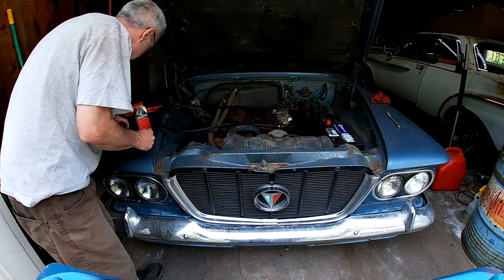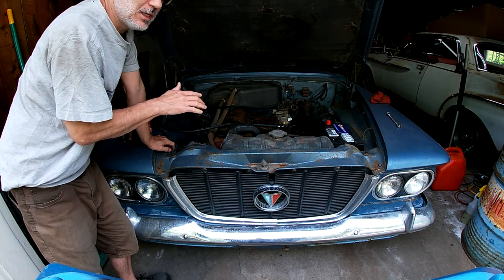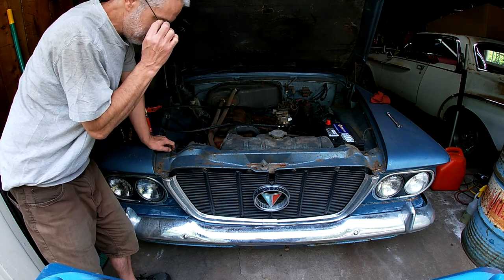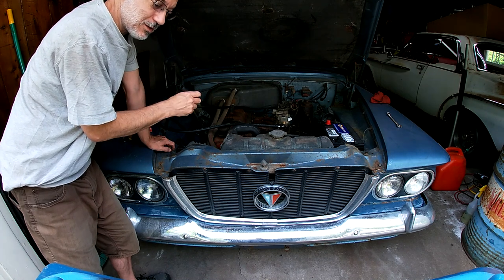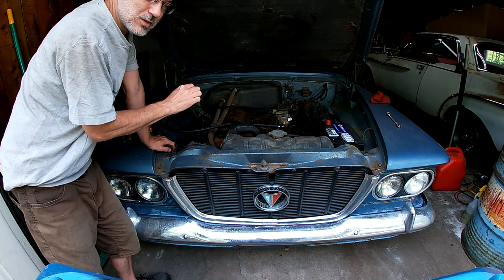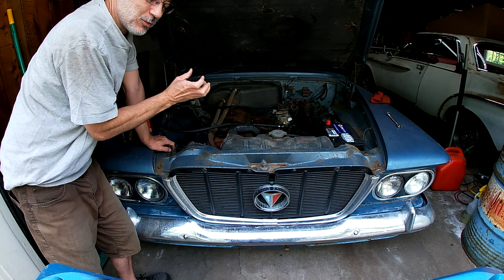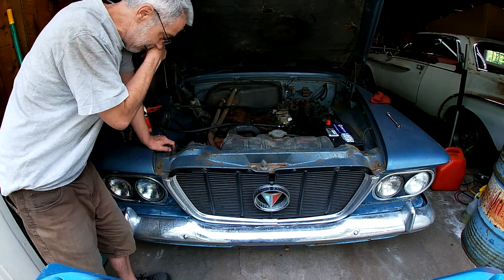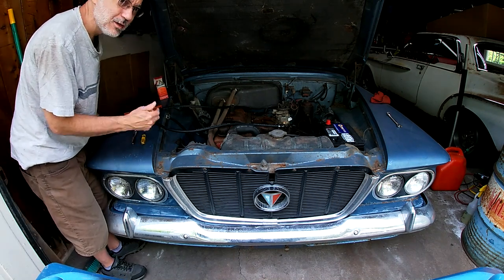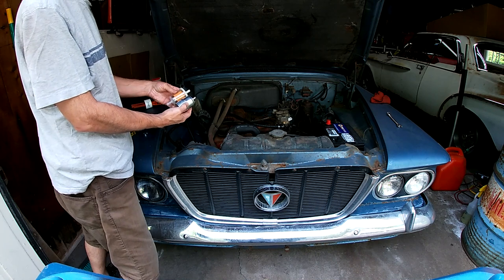That's another story. I actually used, in the Barracuda, I put in fuel injection, and the tank comes with the fuel injection sending unit. You can buy a plug for it. So I bought a plug for that because it has the neoprene, I think, gaskets and the little round O-rings on the bolts. And you have the little thing that you slide in the tank. It's a whole little kit. And I just cut a bigger hole where the rust was at the bottom and put that in, and that solved it. I tried all those patches and the JB Weld stuff, and nothing worked. And that's been working for years. So the idea is when I see this running clear, however many filters it takes, I'll pop this one back on.